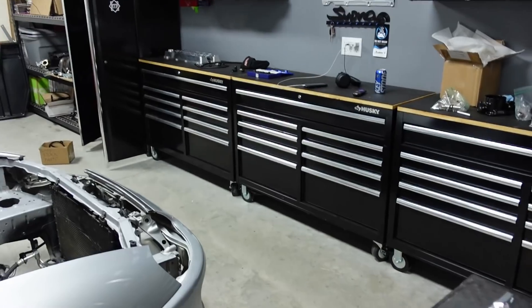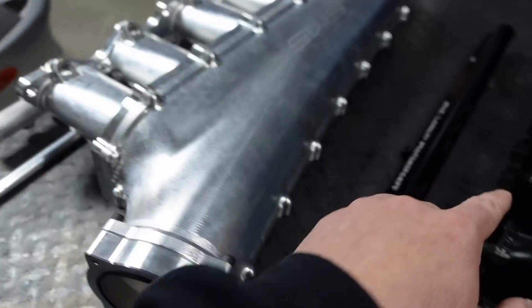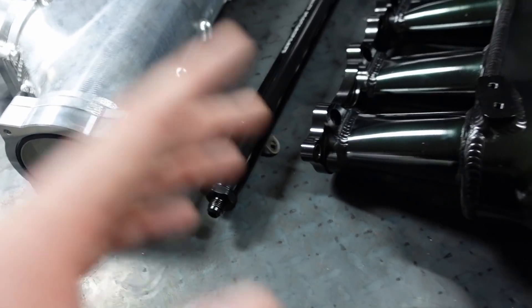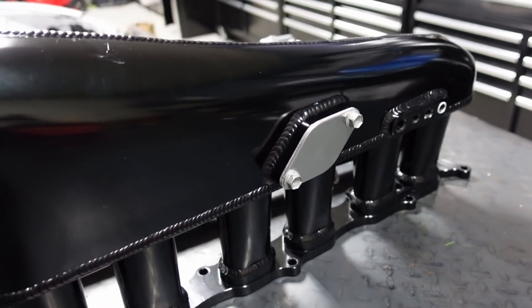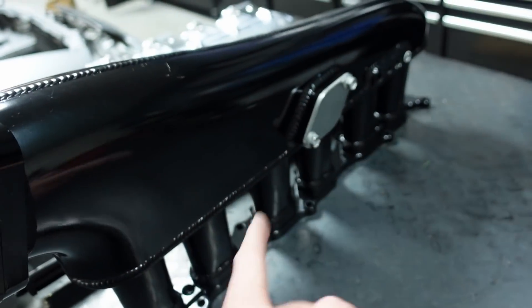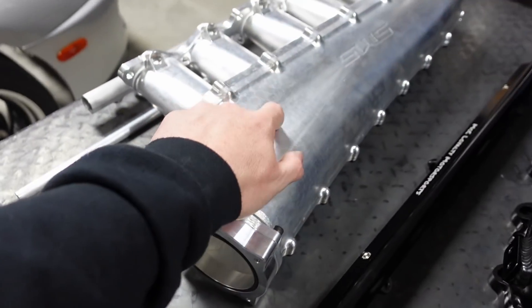On to injectors — it will fit my injectors; I think these are 17mm, I have to double check. It does check out that my injectors from Fuel Injector Clinic both slide right in. There's no need for an aftermarket boss — it's already machined, just like this one is machined, fits right in. Looking at the bottom side: the MCC already has a mount for the idle air control valve and has four ports. The SMS has five ports, eighth-inch NPT on the bottom — and since it's drive-by-wire, the idle air control valve was removed, but you can add it for no extra cost.